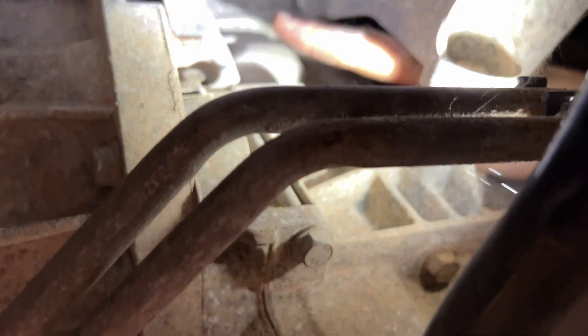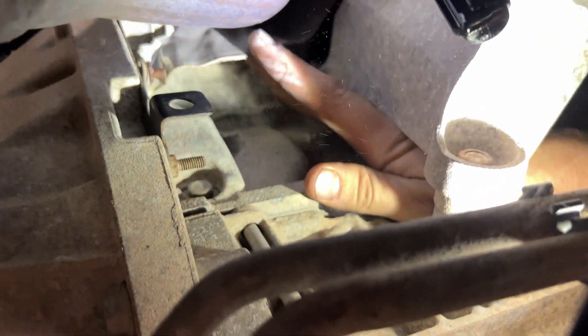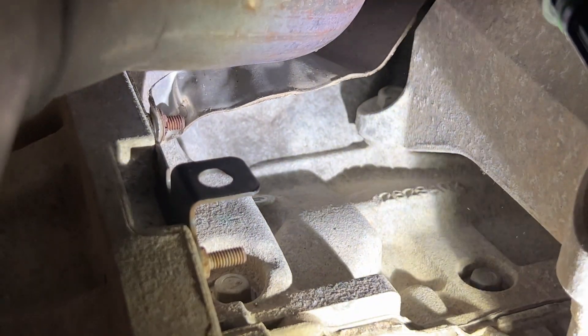It's just sitting right over here. The 10mm bolt is easy to get to — you can get to it with a wrench. That shield is paper thin; you can just move it out of the way. Once we get that off, you're going to basically need a video scope to do this. That's how I did it. I'm not sure if you can do it with an inspection mirror. We're going to stick a video scope down there, and then I'll get the bulletin up so we can take a look at that too, and rotate the crankshaft to see what it looks like.